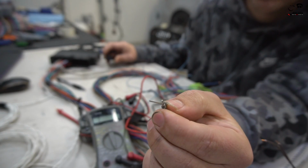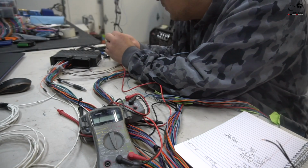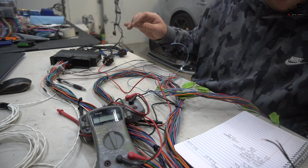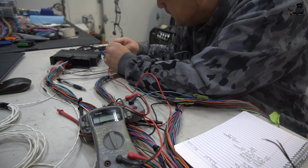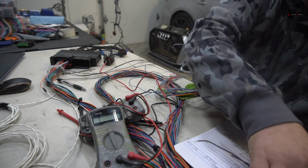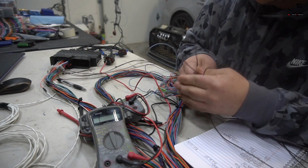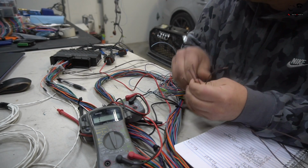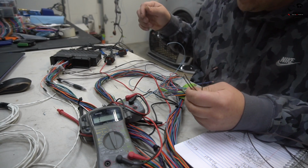So basically what I did is I soldered a paper clip on there, and we're now able to put this inside the hole. And okay, I put that in the wrong one too. So let's say C2, C3, C4, put it into C4, and then here we are, we have the wires for all the sensor grounds. Only one of these pins should have continuity, because on this one terminal, pin 11 in the OEM connector should have continuity.